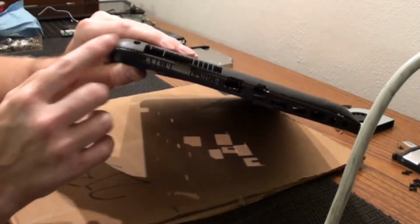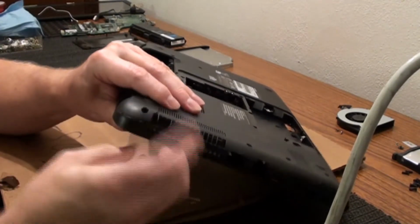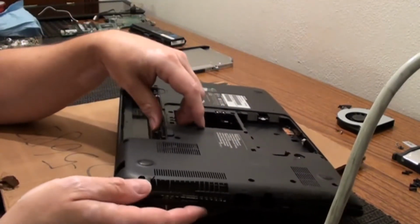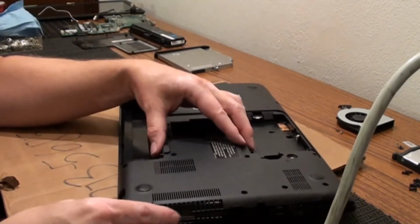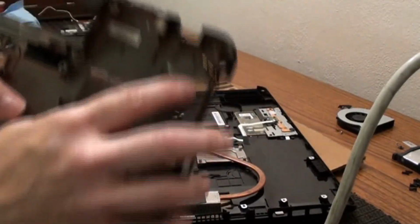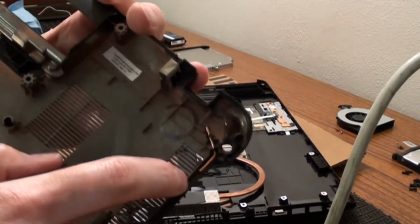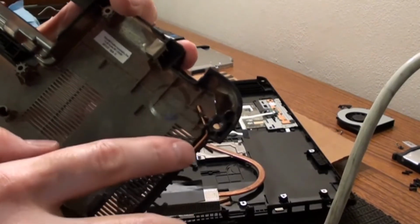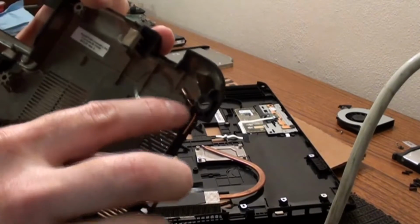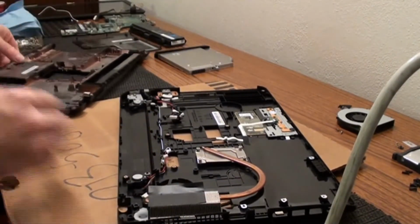I'm working on this corner because that's the corner that has the broken hinge. And I just wanted to show you what I did just to kind of help support it right now. I'm not done yet, but to help reinforce it before I put epoxy everywhere, I actually melted in a 14 gauge piece of wire right there, melted it into the plastic, and I'll put epoxy over it and around it to help hold that corner so it doesn't break.